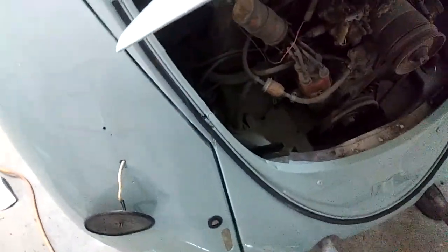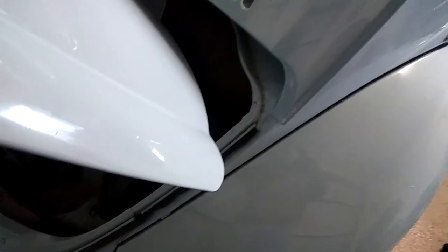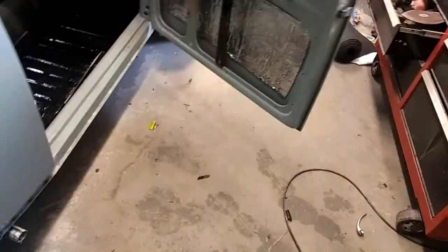I got the license plate light on. I'll do a shortcut here that people might hate me for — I open up the license plate housing so I can run the wire through it, because if you ever have to take your deck lid off you'd end up cutting the wire or dealing with that hump. The wire's not long enough otherwise, so it's much easier to just open it up and stick your wiring through.